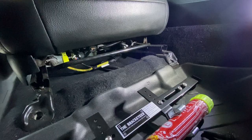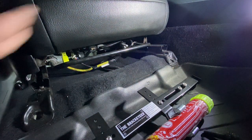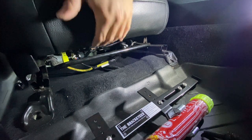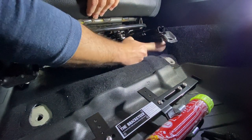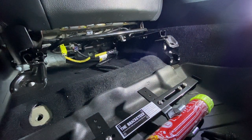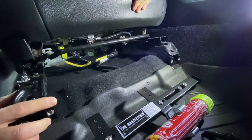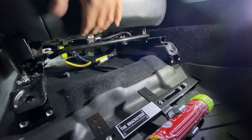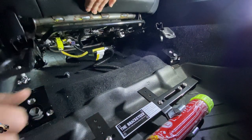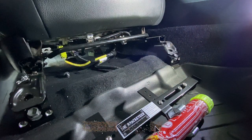Back in the front — don't tighten up anything in the back yet until you get your positions set here first. Here are the seat jackers, and this is why I believe that pin is so important. If you lift up your seat, there's a pin right here that aligns the chair. All you're gonna do is pop this into that spot, grab the other one, follow the pin, push that in. Make sure the pin gets into where it needs to go — that is solid. Take your factory bolts, get those back in. If you can get them on with this down, that means you're in the right spot.